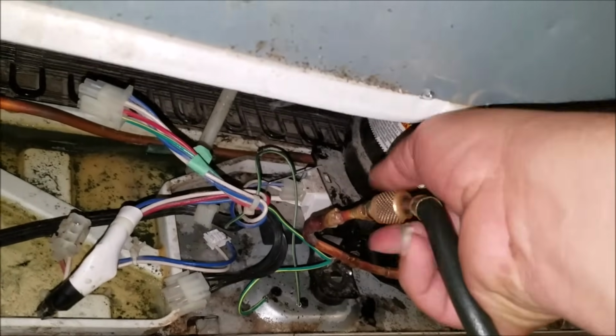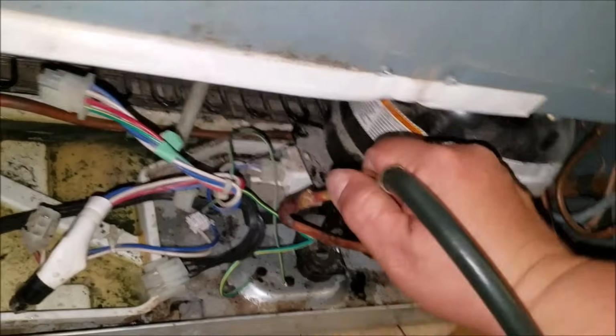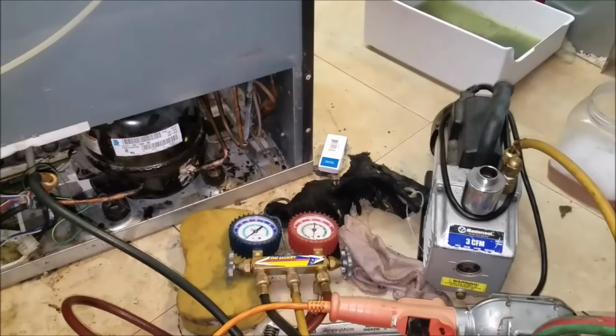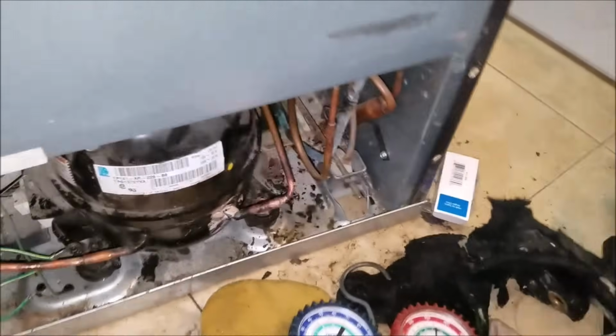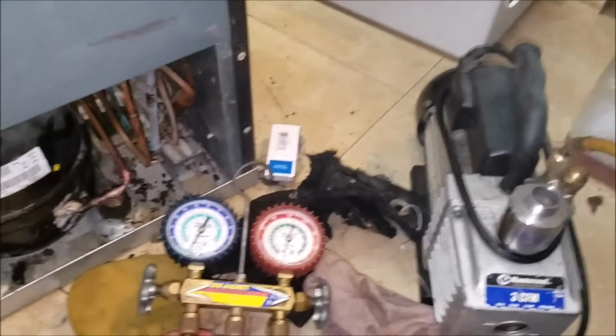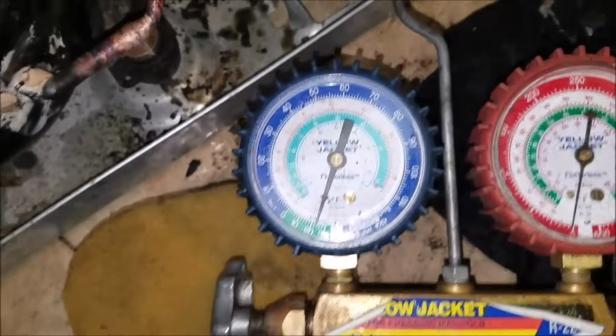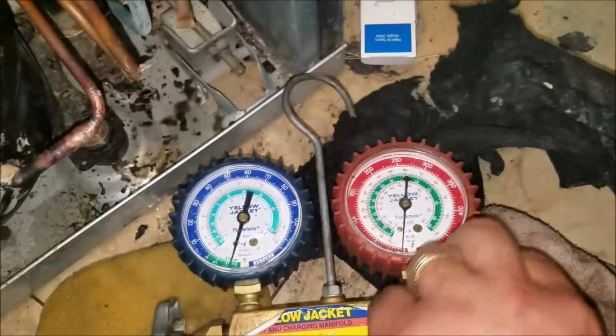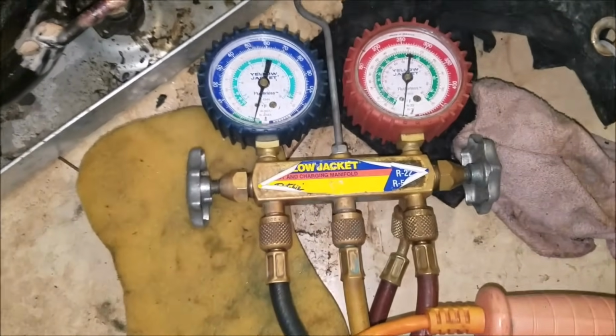It's supposed to hold 30 inches of negative pressure, which is vacuum. If it doesn't hold at 30, that means there's a leak somewhere. Now we're going to go ahead and put the vacuum. Turn on the vacuum, and as you see, it's already pulling vacuum. Like I said, it has to get to 30. Just run the vacuum pump between 30 to 45 minutes. Then while you do the vacuum, go ahead and reinstall this harness